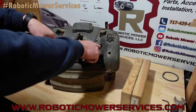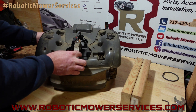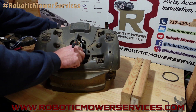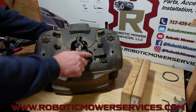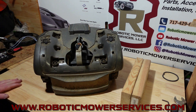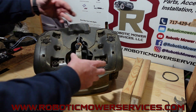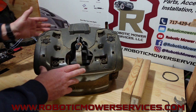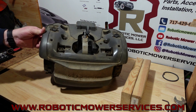Now in this cover part, your fender assembly, you have your charging contacts and you've got magnets down here. These are what tell the mower if there's a collision — if it ran into something. These magnets will slide back and forth over top of sensor boards that are inside this housing, which you'll see once we get this apart. And you have your snap lock caps here — that's the official term, or grommet bushing — that snap down over the joysticks.